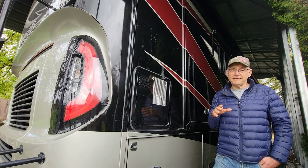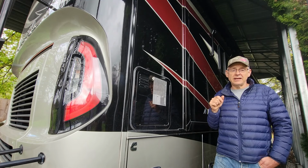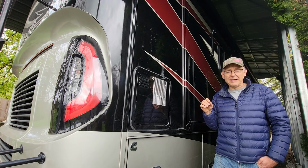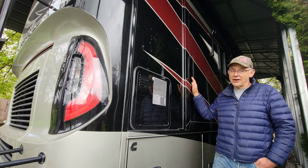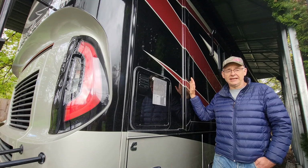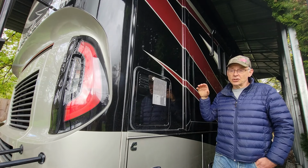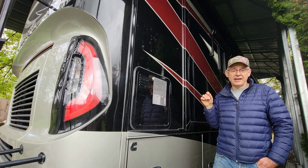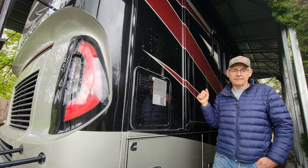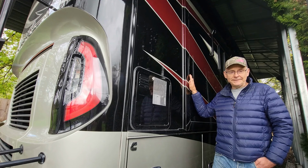Now, some of the best stuff you'll find is by Darren at myrvworks.com. And the Lippert Schwintek videos are pretty good, actually, but they're kind of done in a lab situation, and they don't really work you through how you're going to solve this problem. So with some of Darren's troubleshooting techniques, I was able to determine that I had a bad motor. The controller blinks told me that it was bad, like shorted wires or something, but I guess a bad motor gives you that same result. Regardless, it was a bad motor.